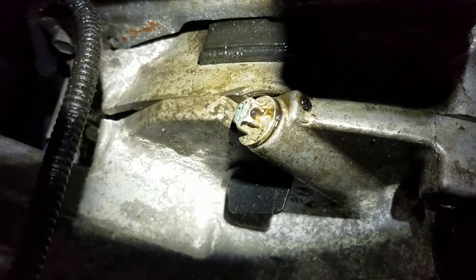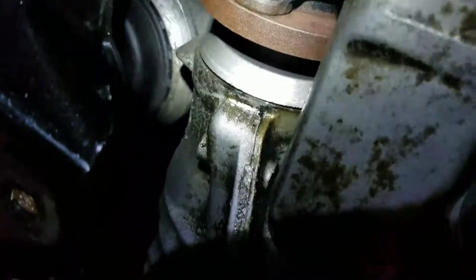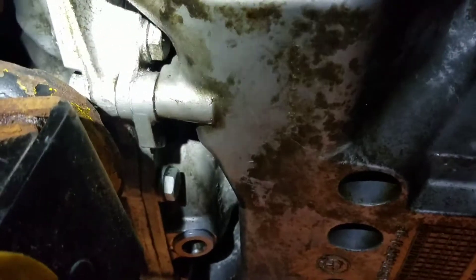While I was down here I actually learned that it looks like the rear main seal is leaking, and the front differential input shaft seems to be leaking too. You can kind of tell it comes down here on the differential — you can tell by the way it smells that it's gear lube, or gear oil, whatever you want to call it.